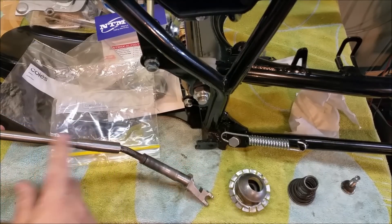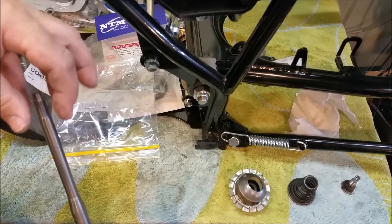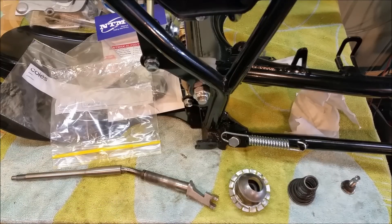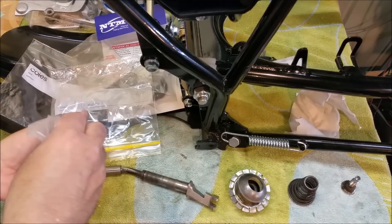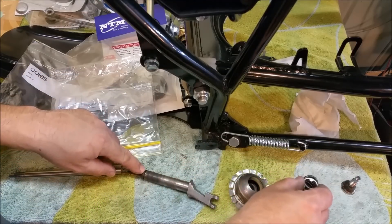So I made this shifter here. I've turned the end of it so we can fit our nice gear knob on — a single rail gearbox knob, with the single rail pattern. You should see that — that's a top loader shaped one. Very few cars would have had that from factory, I'm assuming. Some Cortinas and some XB Falcons. It would have only been reproduced because of the GTs of that period, I would think, because they stopped using top loaders at some point. Anyway, that's the circlip, which goes here over the spring. So we're good.